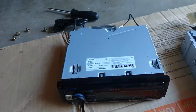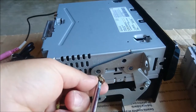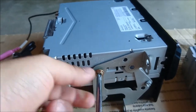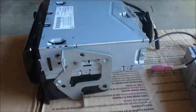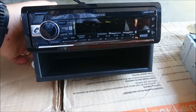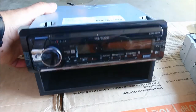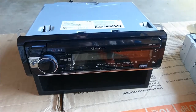So we're going to go ahead and mount the brackets onto this deck here. I've cleaned out the cubby holder, lined up the radio with the openings on the side of the Kenwood, and aligned it with the front of the cubby holder so that it looks correct. Now I'm just going to go ahead and fasten in these Phillips screws. The deck's all set to go — the storage pocket is on the bottom, it looks great, and it's ready to go back into the dash after we finish the wiring.